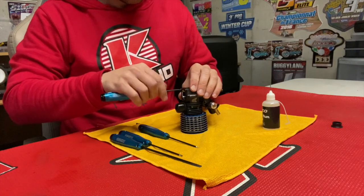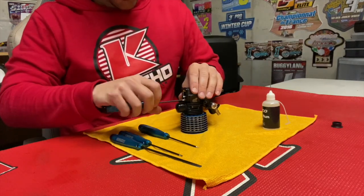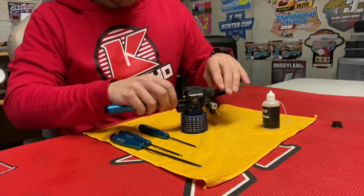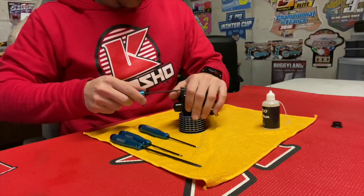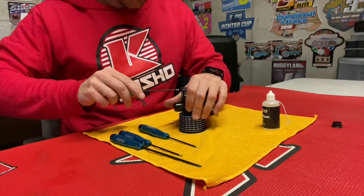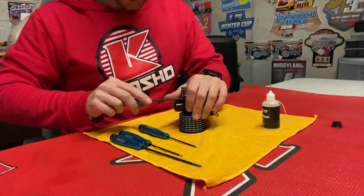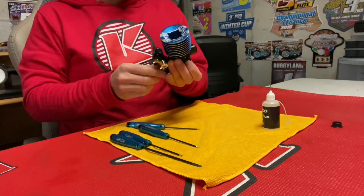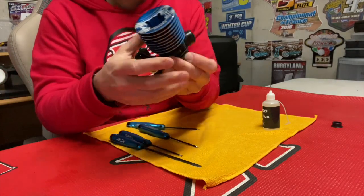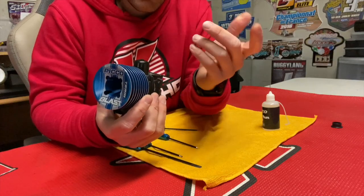This is going to prevent the rear bearing from rusting, which is really good. Usually when your engine sits on the bench for too long and you don't apply after run oil, if the bearing rusts, then it's done. The next start you're going to do, it's going to be really noisy, and you need to change the bearing. So this is really going to avoid that problem. So my engine is fully back in. It doesn't really require big experience, just being careful.